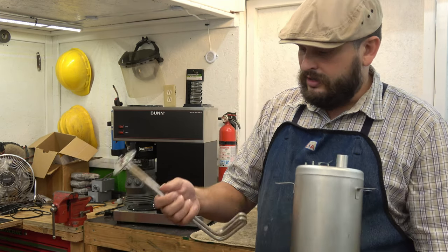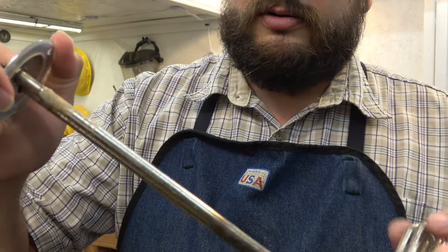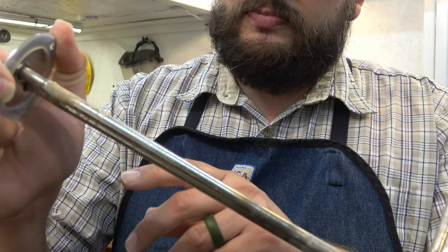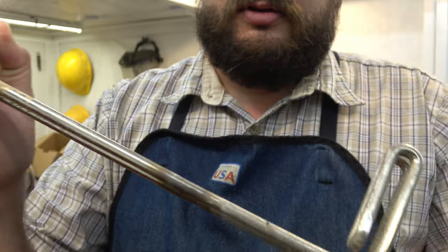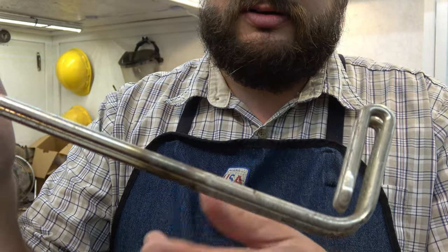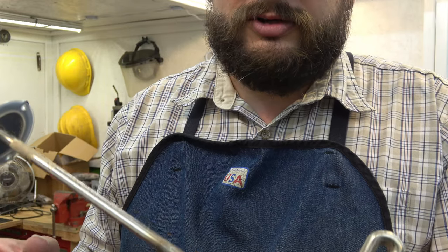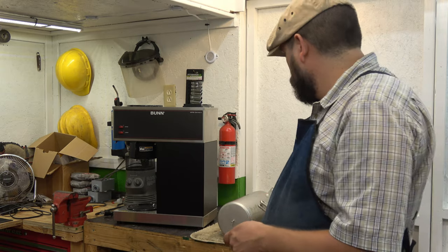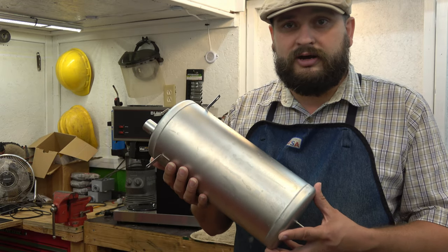So the water gets down low, and I'll show you what happened on the element. This is the element, and this is the normal water level — you'll see a lot of hard water deposits on this. It's Florida, lots of hard water. I recommend people use filtered or bottled water, but you're still going to get some deposits. Well, if you look down here, this is where the water got down to. It didn't completely empty, but it did do some damage to this element. When they went to add water to the tank, they added what they normally would, and nothing came out. After a while, the gentleman was able to get water out — because the tank was finally filled up and then the water came out.